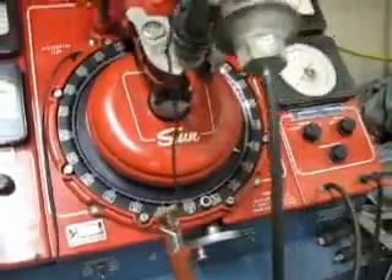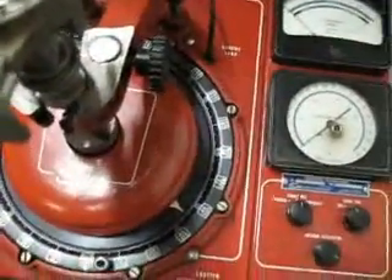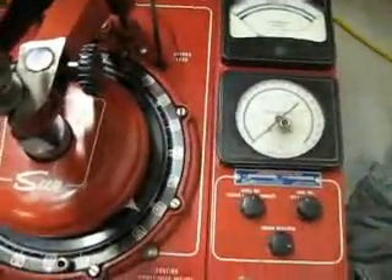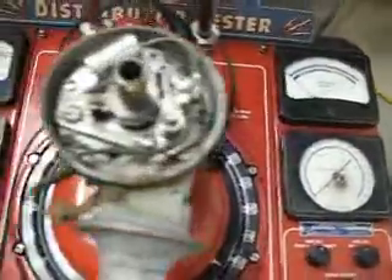And it's a lot brighter. As you can see, I've got my lights on and I don't need to dim the lights or any sort of shading to actually see what's going on here. I changed the flash tube and some capacitors and a couple of diodes and got it working. So I'm going to show you how it works.